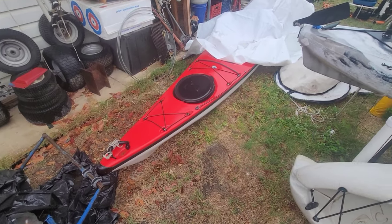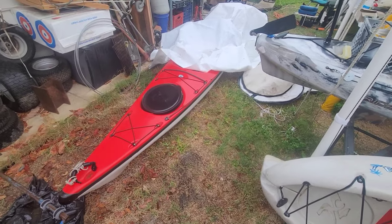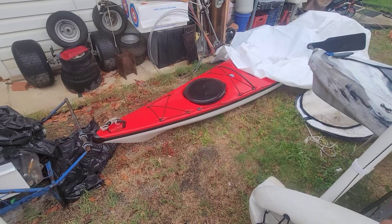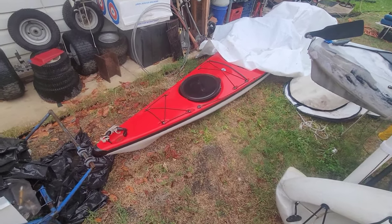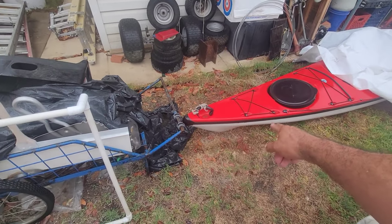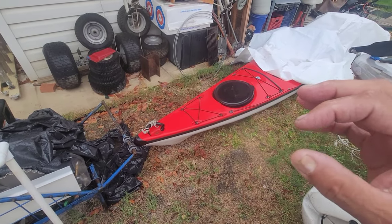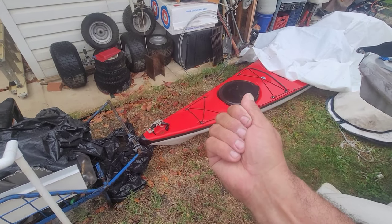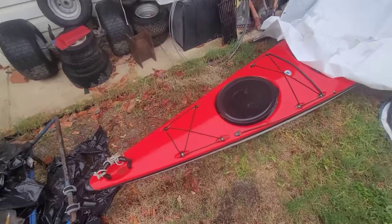The keel had a big crack, probably 12–13 inches. I put some white ABS plastic — which the previous owner gave me — into acetone and it turned into a thick liquid, like marshmallow cream. I painted that into the crack, taped the crack shut, and it had a chemical effect that actually melted the two sides of plastic together, plus it was the same plastic material on the inside.